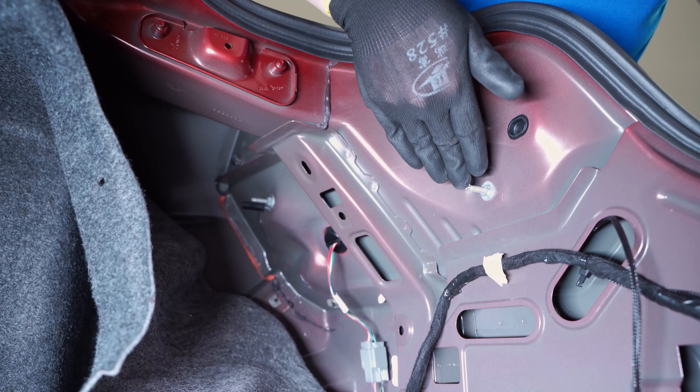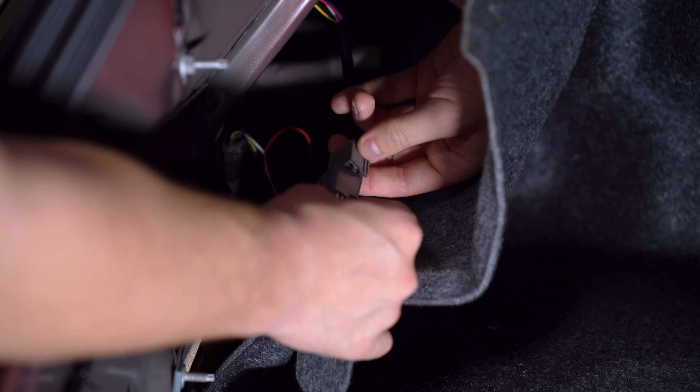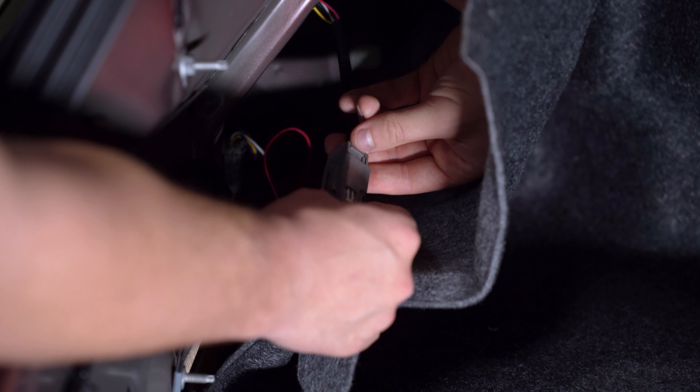You can remove these using a 10 millimeter wrench or a 10 millimeter deep socket. Then we can disconnect the wiring harness and pull the tail light off the vehicle. Before we set this aside, we'll be needing to remove this plastic panel to transfer it over to our new Form tail lamp. It's only held on by a few clips — all you need to do is pull outward and it should come right off. Then we can reinstall on our new Form lamp. Now we can install the lamp on the vehicle by reversing the same steps we used to remove the stock lamp.